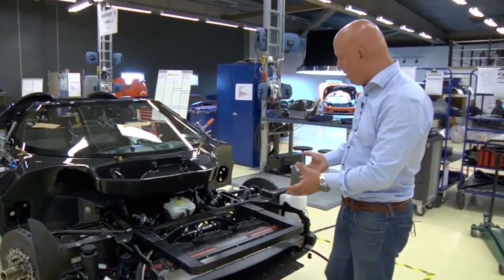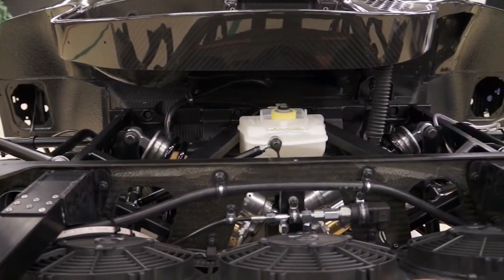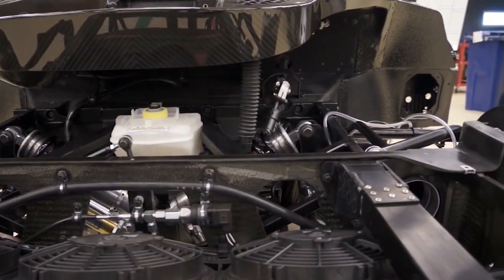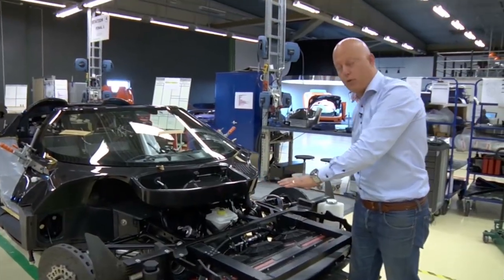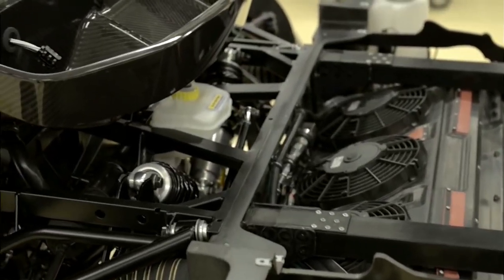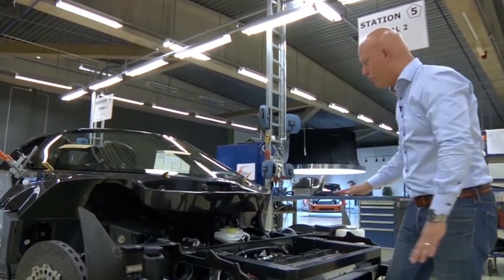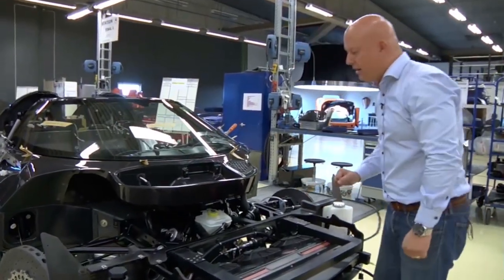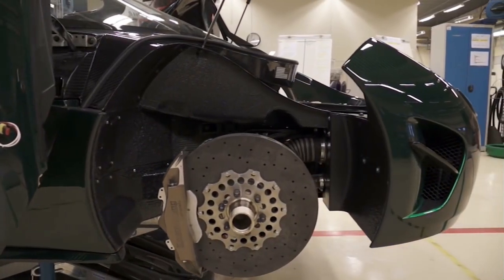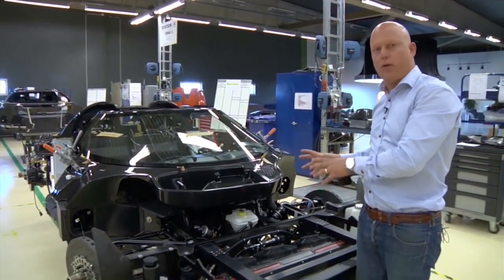At the front of the car we can see a similarly complex suspension layout, and everything here is very, very low — to achieve as low a centre of gravity as possible, but also because we needed to make it low to be able to get our roof into the car, which is a very unique feature. We couldn't have anything in the way for the roof to slide in. But it had the side effect of also lowering the centre of gravity — a perfect example of two needs working together without compromise.